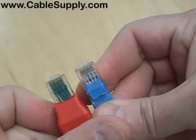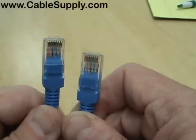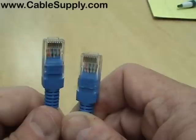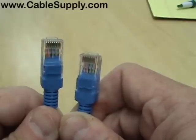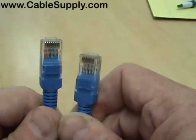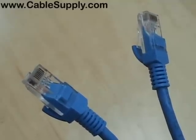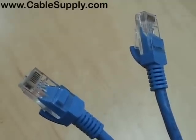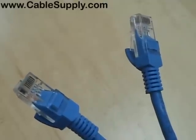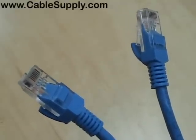The other situation requiring a crossover cable is when you connect two switches or hubs together — like equipment needs crossover cables. Unlike equipment, such as PC to switch or switch to router, needs straight-through pinouts. Some Cisco technicians may notice they connected switch to switch without a crossover and it worked — that's because some Cisco equipment has built-in logic that recognizes when a straight-through is used where a crossover is needed and adjusts automatically.